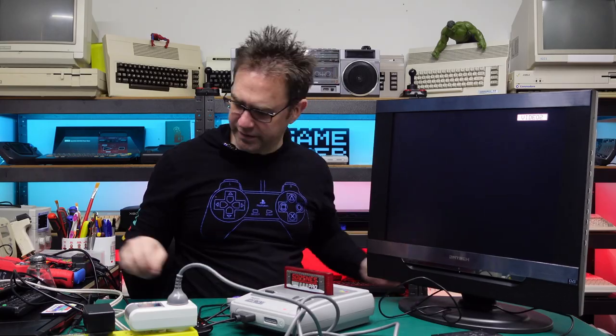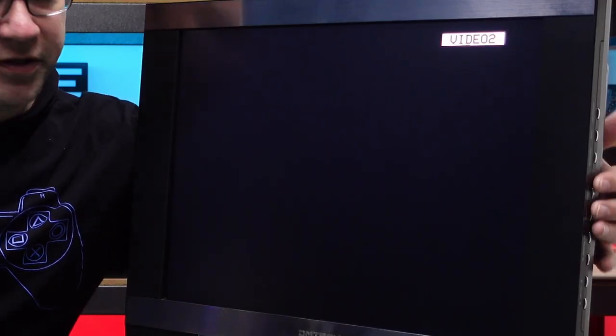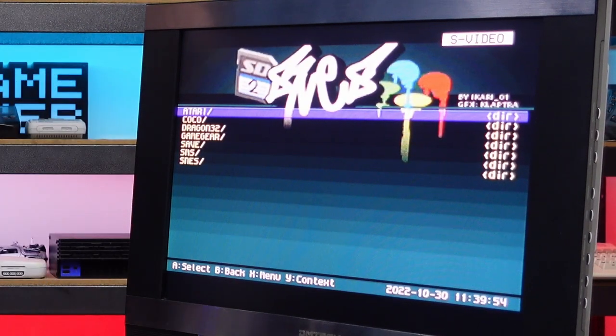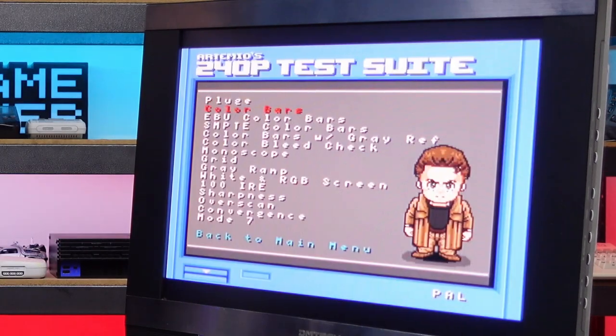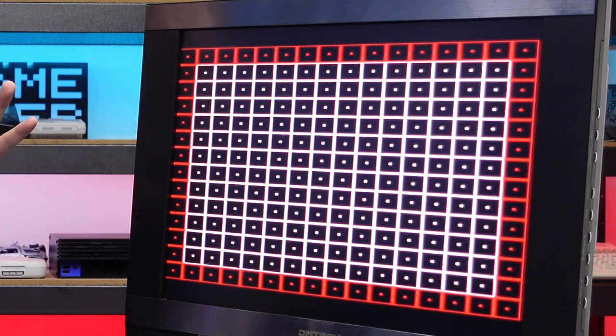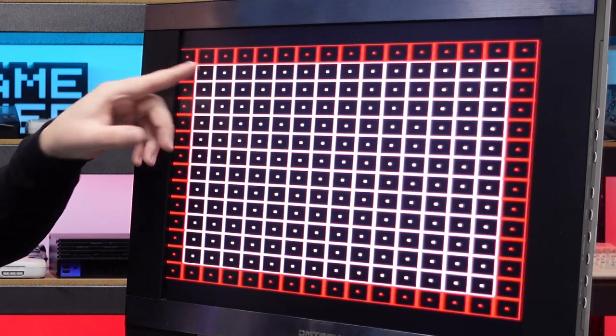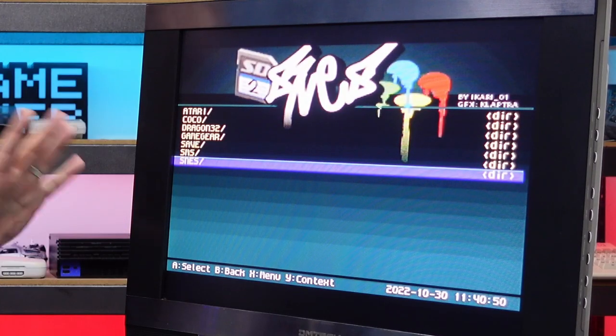For S-Video I use a decent cable because it's much more prone to interference with a cheap unshielded cable. As expected, S-Video looks a lot clearer and the red text is pretty much solid — there's a little bit of blur but that could just be the Super Nintendo itself. It could also be because this is a 640x480 LCD panel with fixed pixels; it may not be scaling things correctly to two or three pixels. But S-Video definitely gives a boost in clarity.